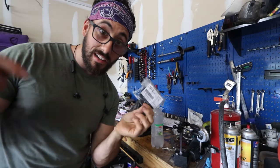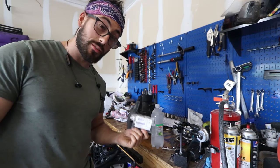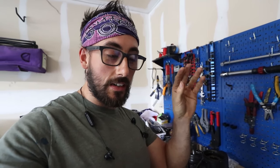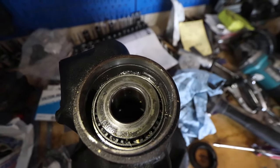Here's the part number just in case you need it - I'm going to put all this stuff down below. Now take a look at this - this is why it's a terrible idea to weld the diff with the pinion side down. Look at all the slag we got in here. It's bad to do it with a flux core shitty MIG welder and not expect this to happen. You see all those little balls? That's all slag on the side where the pinion is - that's almost impossible to get out. That's what was stopping the thing from spinning, because all those little balls dropped all the way down in between all the bearings. I'm going to have to try to get it out and see if the bearings are okay.